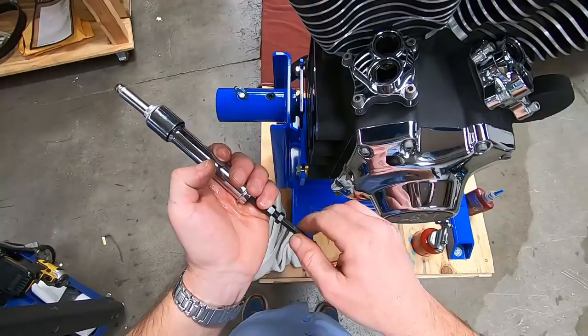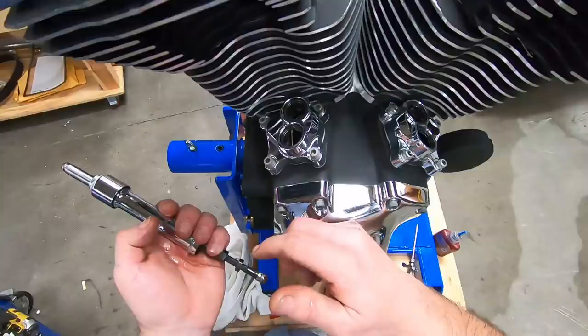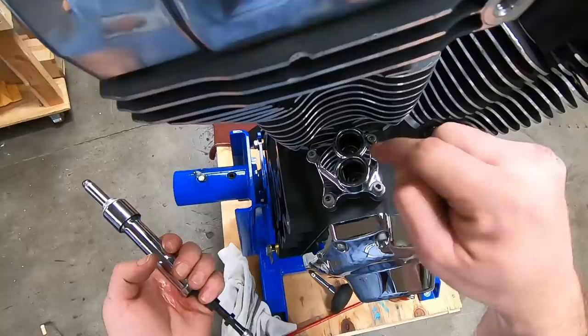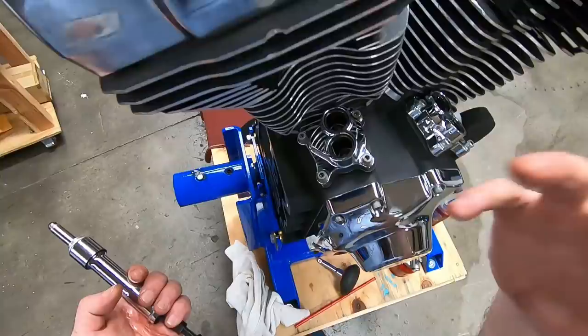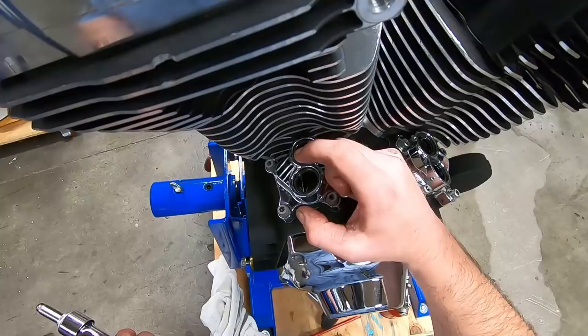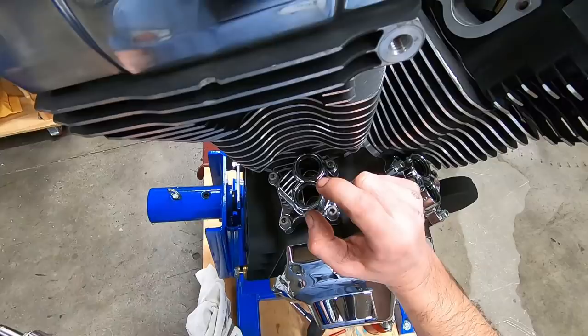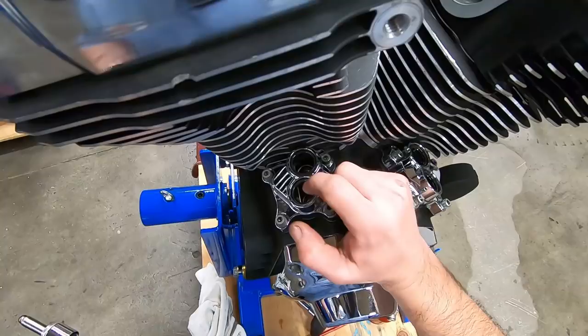Now, another common question that I see quite frequently on push rod adjustment is how many turns? Well, people seem to want to ask the push rod manufacturer. It's really not up to the push rod manufacturer. It's up to whoever manufactures your lifters, okay? Most lifters, anyway, if they don't have travel limiters in them or they're not hydrosolids, are going to have 200 thousandths of an inch total travel on the plunger, okay? Most lifter manufacturers, again, I say most, check yours, want that plunger to be at half of lifter travel. So that's going to be 100 thousandths of an inch down. So you have 200 thousandths total travel. They want it to be in the middle at 100 thousandths.